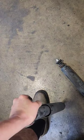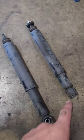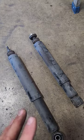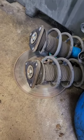Last week I recommended these shocks and these struts because of tire cupping. Look at this — see that? That shock has failed. There's no leaks on it, there's no leaks on the visible either, but you had severe cupping of the tire.